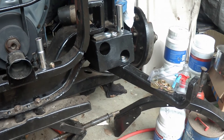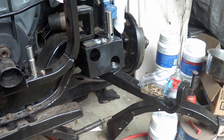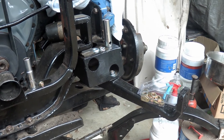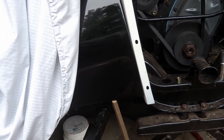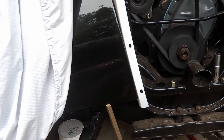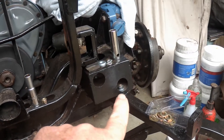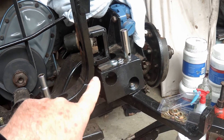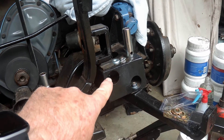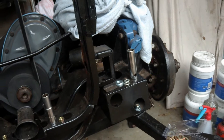I found another piece that I missed doing - putting the bumper bar mounts on. I should have done that before I put the guard on, even though I haven't bolted the guard up fully. The reason for that is getting access to the bolts. There's a hole in the front here which is covered by the guard when the guard's on, the other hole here, and there's a big hole at the back there to give you access.